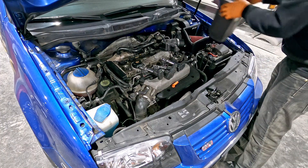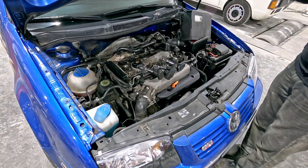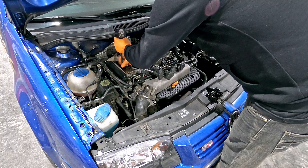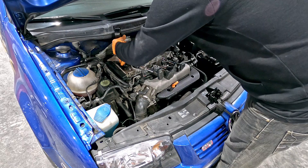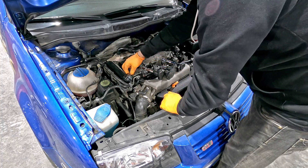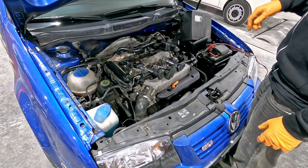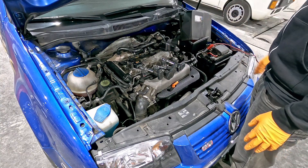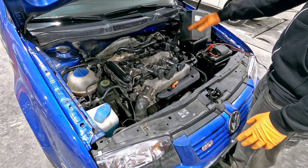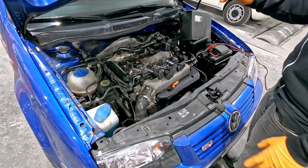Next up I always put a battery charger on it so that every time we're cranking it, each cylinder is getting the same voltage with no variance as the battery gets weaker — we want it consistent across the board. Then throw the compression tester in, snug it up, make sure it's at zero. Jump in the car, crank it over, and be sure to have your foot on the throttle for wide open throttle. The key things to remember: all plugs out, injectors disconnected, throttle body open, and make sure the engine is warm — those are the big points a lot of people miss.